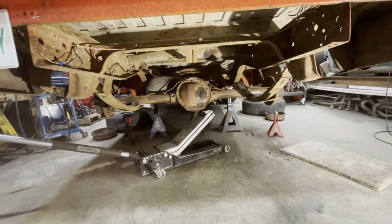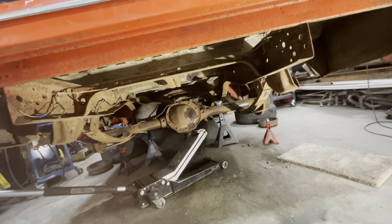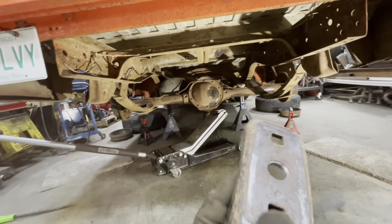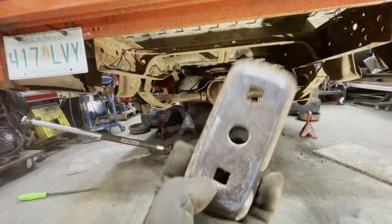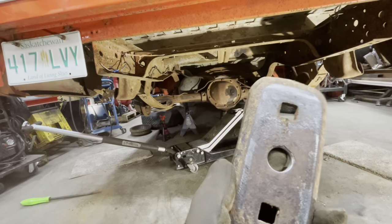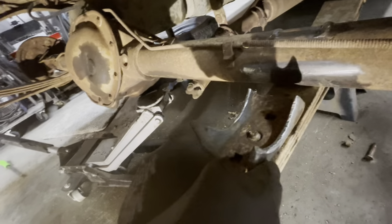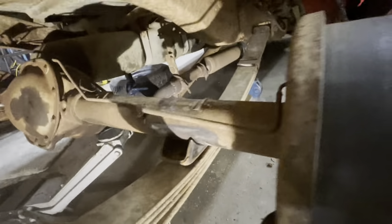Just like that, we got it weaseled in there. It does fit - you just need to pry down on the springs a little bit. It hits the alignment pin on the backing plate. Another thing - you have to drill out this center hole because there's a nut on the top of the spring pack that holds the pack together and it doesn't fit in the hole, so you just make it a little larger. This nut here is just a little too big to fit in the original hole, so you drill that out, it sits in there, and then you set your diff on the pad.